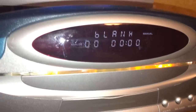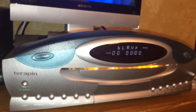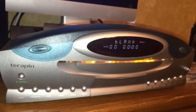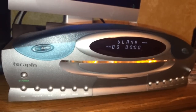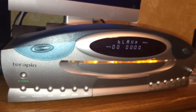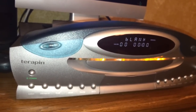There's actually a Record Level Meter that comes up on the screen. And if you've never made a disc of any sort on any kind of equipment, you know that you can record onto the disc, but the disc is not ready to be shared with another machine until you finalize it — that's part of the process. If you don't finalize it, this machine will be happy to play it, but as soon as you put it into a computer or a DVD player that plays video CDs — and a lot of DVD players on the market will play video CDs — if you don't finalize it, it won't play on those machines.